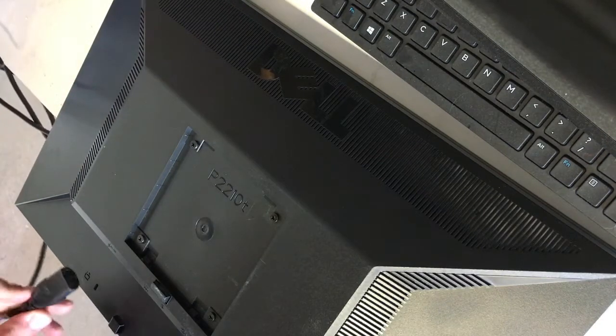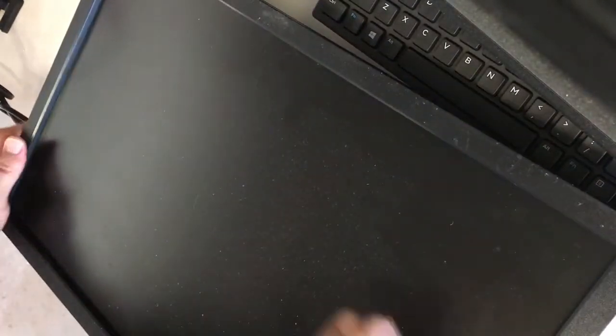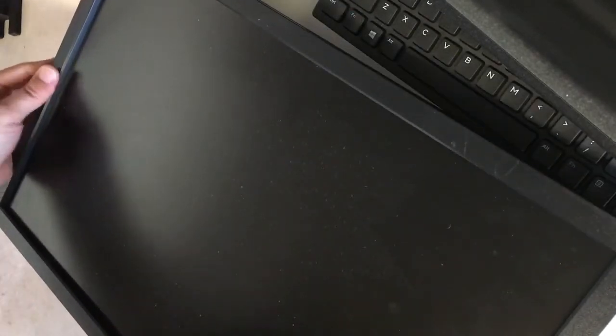To determine that, one thing I usually do is plug in the monitor after removing it from the base and see if it'll power on and exhibit the classic symptoms. The monitor does power on when I push the button, but nothing happens on the screen — the screen just remains dark and black. The backlight is not working at all. So the easiest way to fix that is to open the monitor up, remove the power, and take a look at the capacitors to see if they need replacing.